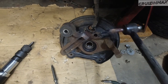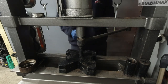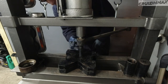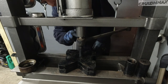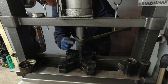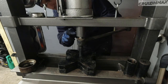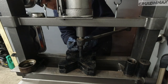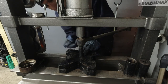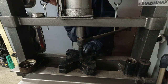So that came out — heat, heat, heat. Alright, the plan here is to save this bushing at all costs. I got a 16mm socket — I cut out the bad part so the actual bolt that's left is about here. The plan is to leave that smooth area, just push it this way, so that the lower smooth part of the bolt is still good and can still come out. Once I loosen this up I'll leave it alone and then press it from the other side.